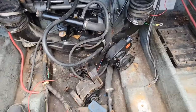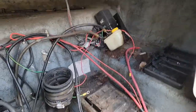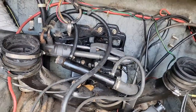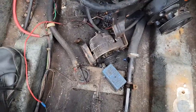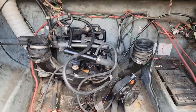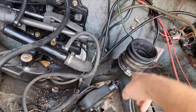This is the Maxim — the second video on the Maxim 2300SC. What I'm going to do today is work in the engine bay again. We're going to start cleaning everything out. As you can see in the first video, I pulled the engine out. Today we're going to work on this trim pump over here. I need to check it out, jump it, make sure it's all right. I'm going to hook up to this battery here and test it, change the bracket as long as that's all it needs. Back here we're going to pull the alternator and power steering — the alternator itself is pretty trash looking. I don't like all the rust and corrosion; I've got a nice one on the other motor. I'll just drop it in here. I think I'm going to hold off on the transom seal because I really have no reason to believe anything was leaking — it can eat up some time pretty quick. But I do have the exhaust flaps; we'll go ahead and put them in too.